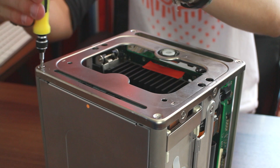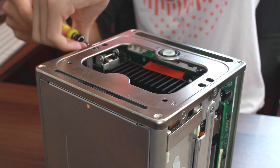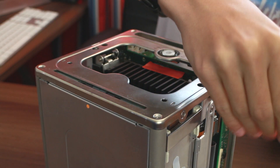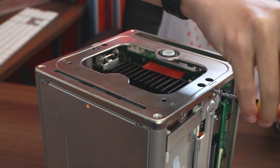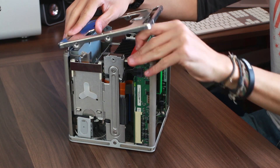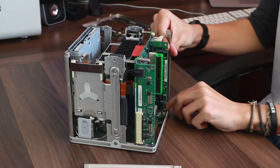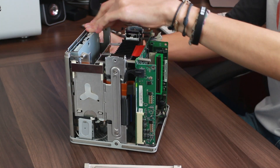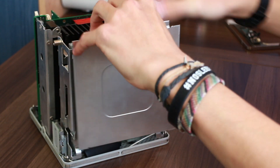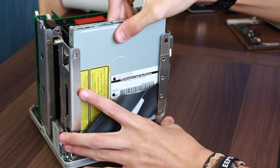After that, it's time to get to work on the first few screws. There's eight of them — Torx T8 screws — and they sort of just hold the main rigidity, the main structure of the computer together. They have a pretty important job. And there we can see the top case being lifted off along with the touch-sensitive power button, which is awesome to have. Then you've got these four structural pillars fixed to the top case, and here is this metal cable-tidy slash blanker plate thing that stops the IDE cable getting caught on the casing as you pull it in or out.